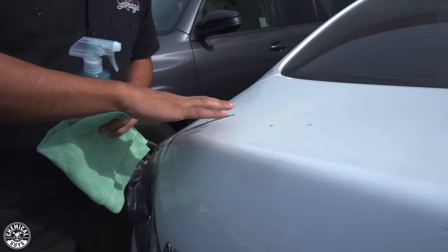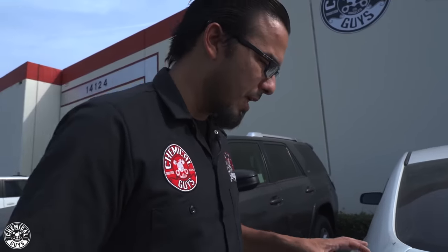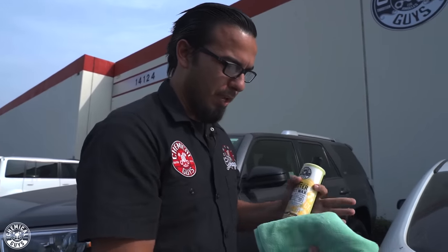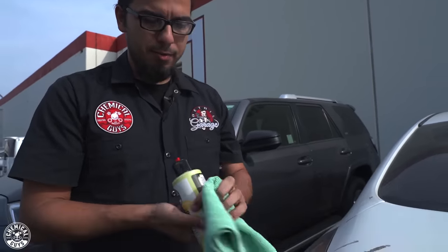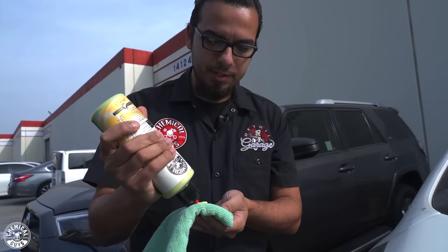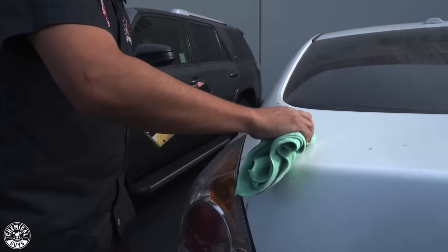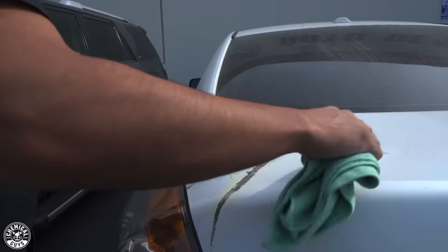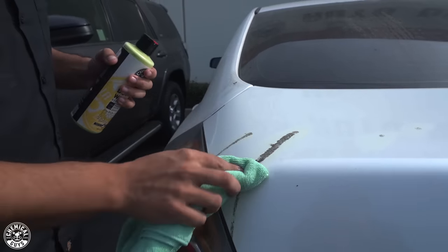We see the stain's still on there and there's a lot of run here. So what I always recommend is if it's fresh, get yourself a bottle of Butter Wet Wax, which has natural cleaning oils that help to lift off any stubborn residue. It also leaves behind a great shine and a durable layer of protection. Butter Wet Wax has a lot of versatility — you can use it for removing water spots, tree sap, and even overspray from spray paint or road paint. It leaves behind a fine layer of carnauba, which makes it difficult for future contamination to stick to the surface and also gives you some water-beading action. We'll start by just blotching it out, giving the oils a moment to help break down whatever we're working on before we go into scrubbing it. This also lubricates the pad or towel you're using so you're not grinding it into the surface and causing scratches or swirls.